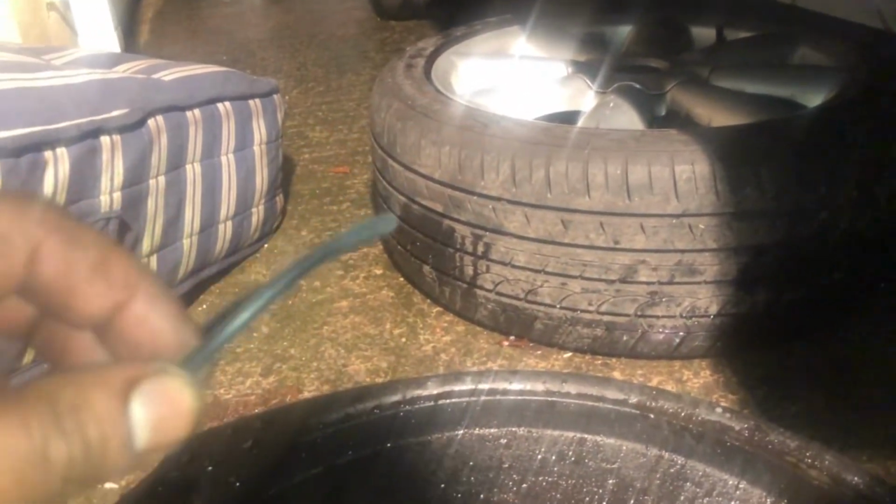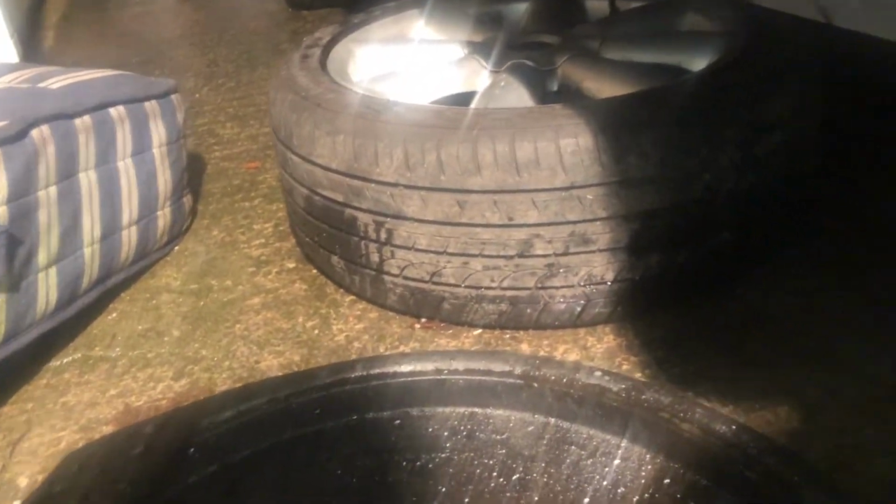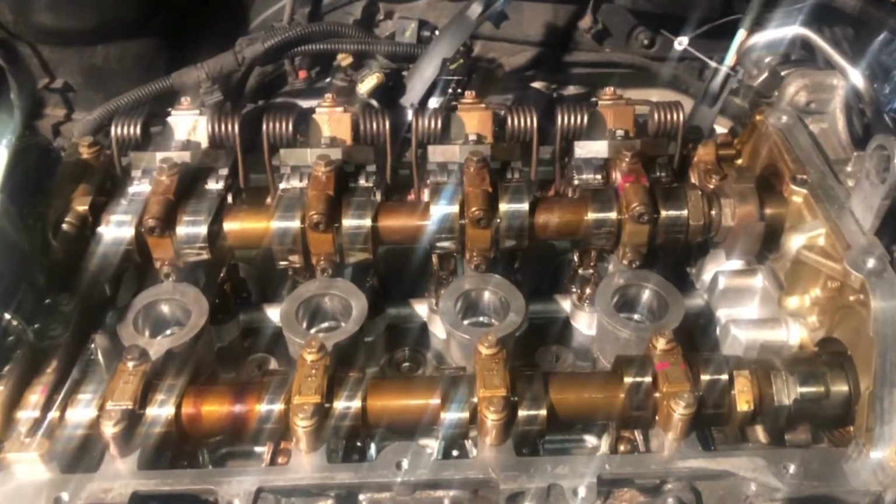The next thing, oil filter there, measured it all up. Make sure you get one of these sealing rings in there. That's all done. So yeah, I'm just going to change that over, and the next step we'll have is putting on all the exhaust side, the turbo and everything, the intake pipes in now.